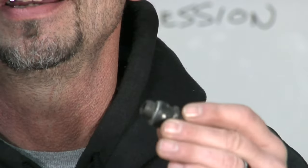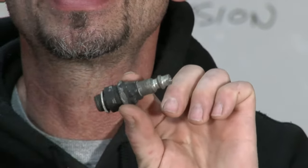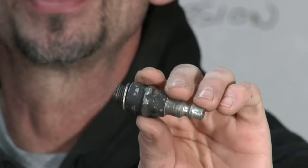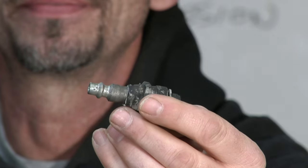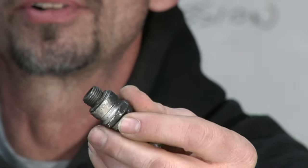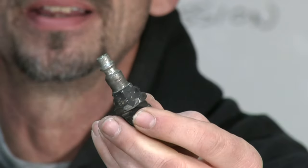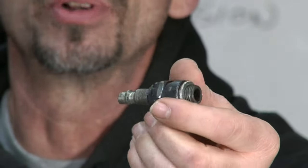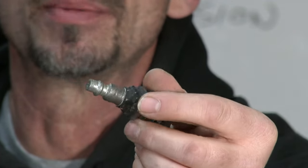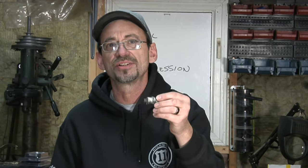I'm going to show you this little thing as best I can. What you can see is part of a spark plug and an air fitting — and that's all it is. All I did was cut the side electrode off, the ground strap off the spark plug, bash the porcelain out of it, and welded it to a pneumatic quick connect fitting. You can weld it to a pipe fitting if you want and skip the quick connect, but those of us with more than one air tool don't want to be screwing, unscrewing, and Teflon-taping every time we change tools. This is basically what you have, and it allows us to connect air to the engine via the spark plug hole.